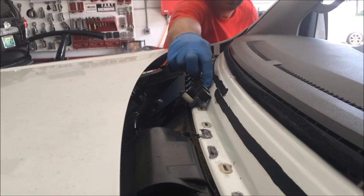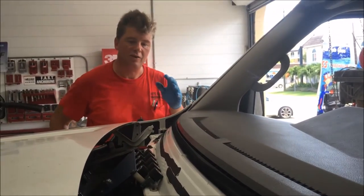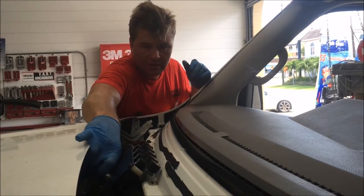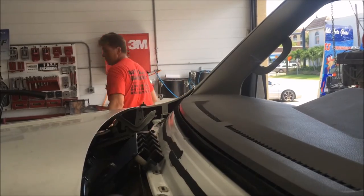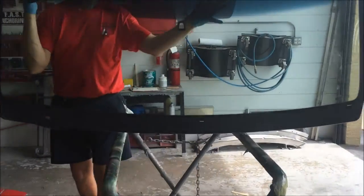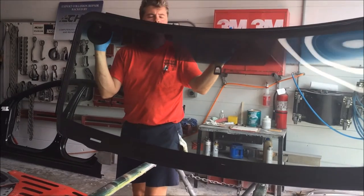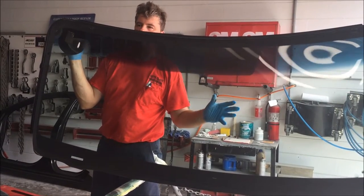The single drop has been converted. We'll go ahead and reposition our deck tool — the wheels are still above the pinch weld so they can turn freely. We still have to make adjustments because we don't have the windshield in the opening; we can't be certain where it needs to be. The easiest way to do this is to simply do a single dry fit. Just secure one of your locking screws with it all the way down, and you can come around to the passenger side to get a side profile. Because the wiper post is more towards the passenger side from center, I'm going to be setting this from the driver's side.